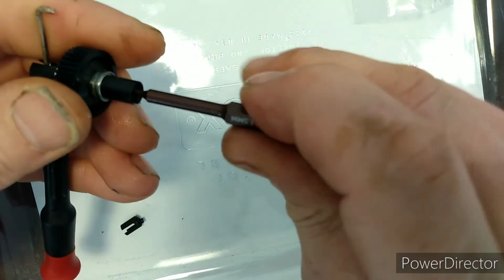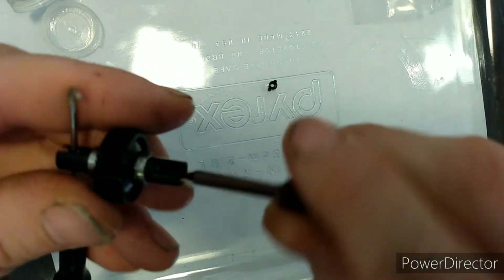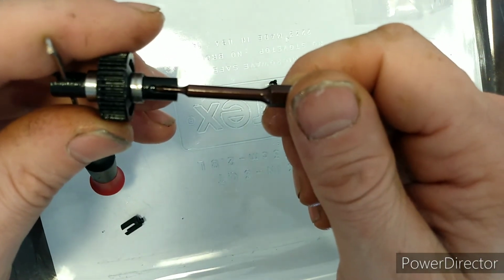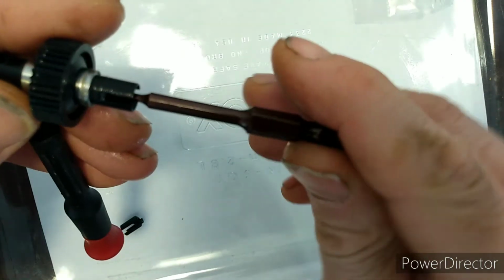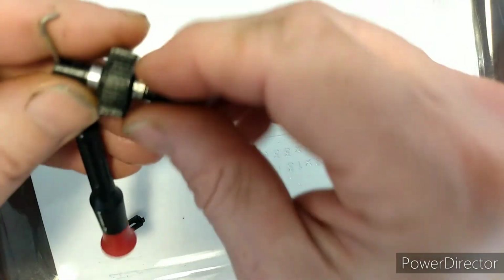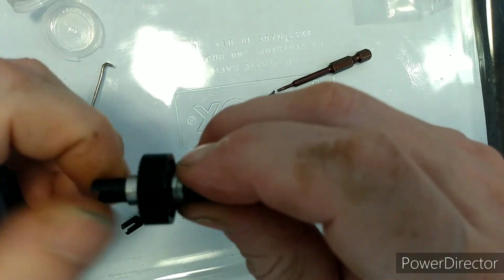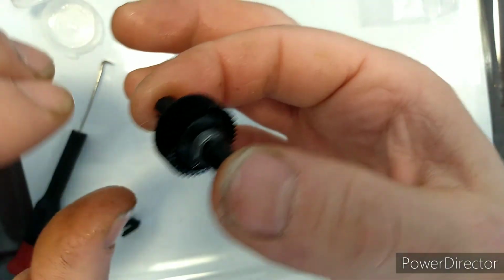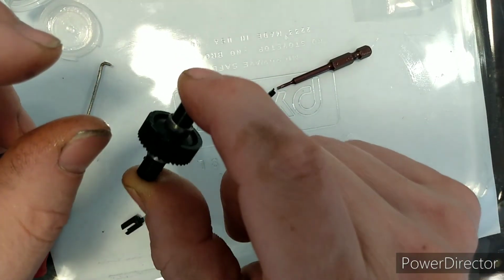Okay. So it says tighten the diff until it just bottoms out. Oop, there. Back clamp screw out 1/4 to 1/2 turn for the initial diff setting. Okay, so let's back it out 1/4 turn. Alright. That is my new MIP ball diff for my Mini T Losi 2.0.